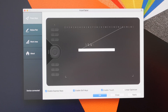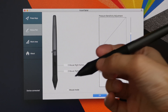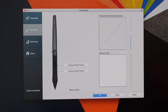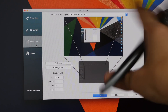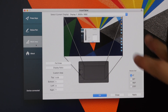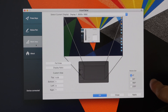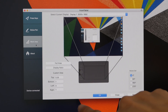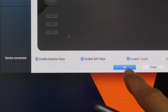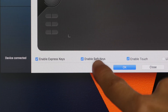This is where you can customize the pressure sensitivity as well as the shortcuts for the two side buttons. Here you can also rotate the screen — if you're a left-handed user you can rotate the tablet 180 degrees so the physical shortcut buttons are on the other side. However, when you do that the soft keys will be at the bottom. If you find you always hit the soft keys by mistake, you can switch them off by toggling the check mark away.